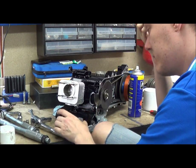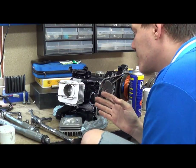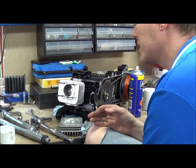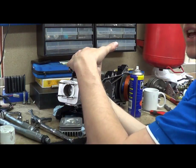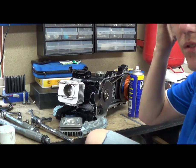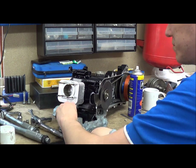So what has to happen here now is that we either get a really thin base gasket, or we pretty much just get rid of the base gasket. The piston will stay where it is; as the cylinder drops down, the head is attached to the cylinder, so the head comes closer to the piston. And that's how you measure a squish with the modelling clay / blu-tack method.